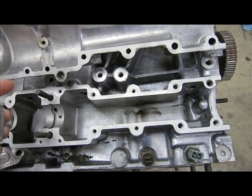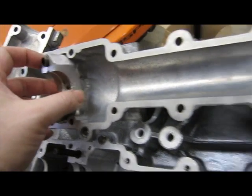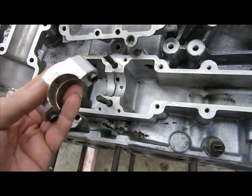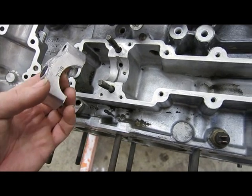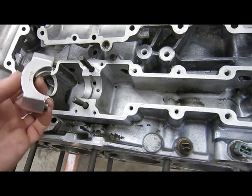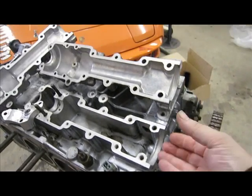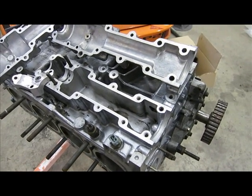Note that this hole is offset center-wise, so this has to go in the correct orientation so that the purple grommet lines up with that boss. Also note the number these are stamped with - this is 7570. The girdle, the block, and the balance shaft covers or caps depending on whether it's an early or late engine are all numbered to the same number, because at the factory they assemble and machine everything together so the bores are all perfect. It's a bad idea to mix and match balance shaft end caps or covers and girdles between blocks because they are numbered for a reason so that they match. When putting these on, I also set the end cap in place to help line everything up when torquing the covers down with the balance shafts in place, just to make sure everything lines up squarely.